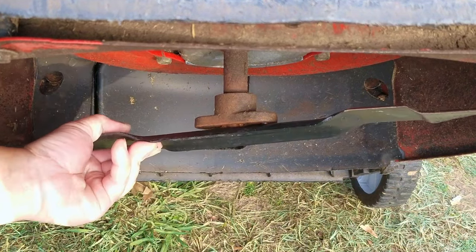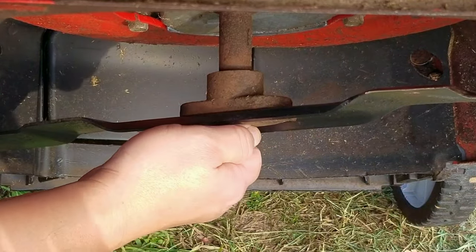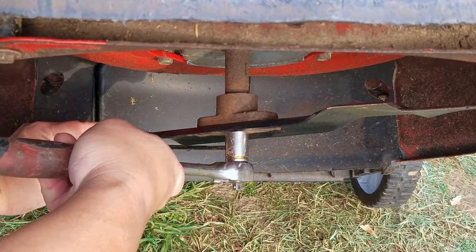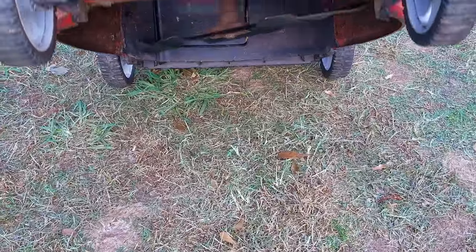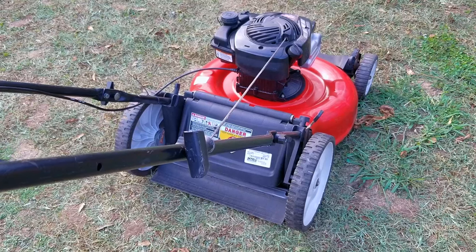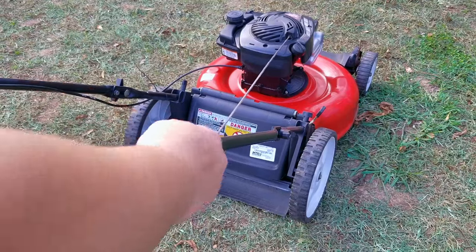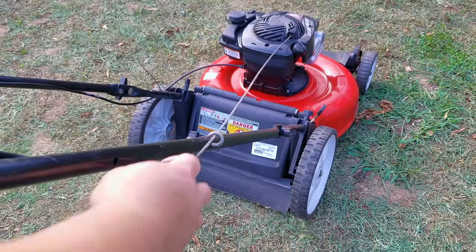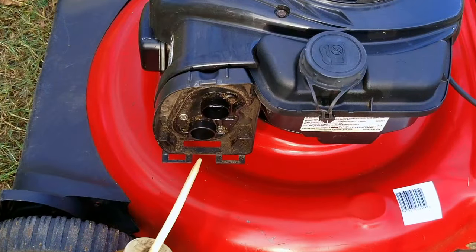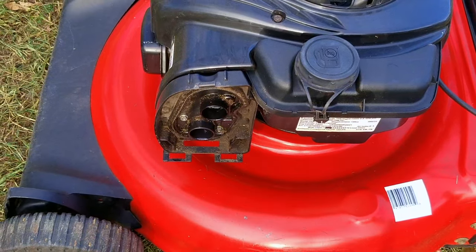At this point I was thinking I'd try and start the mower, but I forgot to install the blade that I took off in the last video. With the fuel tank somewhat clean and fresh gasoline in it, hopefully it'll start — but if it doesn't start we'll try and prime the carb manually. As expected it wasn't going to start, so this is where my chemical bottle of gasoline comes in to spray some fuel into the carb and see if the carb might be the issue.